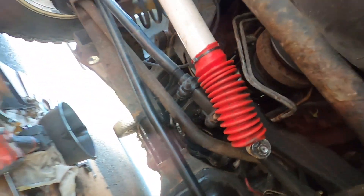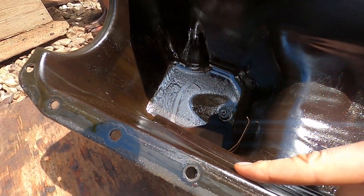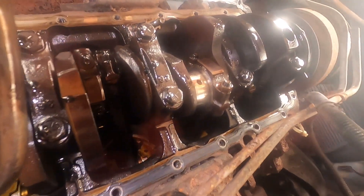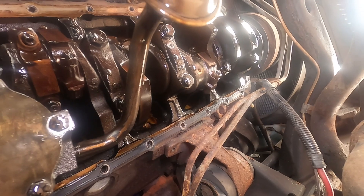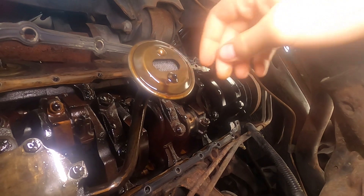As you can see, I already pulled the oil pan off to get that bearing out. There's what it looks like when you have a bearing go out — your oil should not be silver and metallic. I'm under the truck now and you can see the journal where the bearing spun. It's in pretty good condition. My fingernail barely catches on one little scratch, so we'll polish that up.